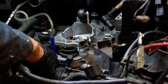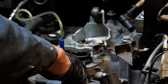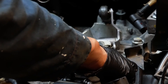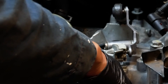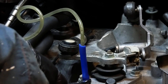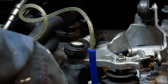Attach the spanner and hose to the bleed nipple and have your helper pump the clutch pedal to start bleeding air out of the slave cylinder. You're going to have to bring it up by hand — pump it up. Once all the air is out and the clutch returns with no leaks, check that it stays up and doesn't get sucked back down. Once confirmed it stays up, you're all set.